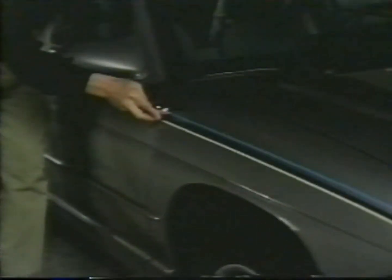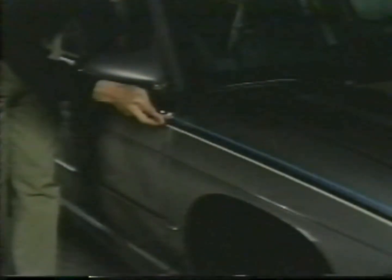As you move from front to back, be sure to remember to smoothly walk backward in a continuous motion with a toe-heel step, one foot behind the other. Do not shuffle and keep your painting arm extended. The only reason to move your extended arm would be to avoid a mirror or door handle, or when in a confined workspace. With very little effort, you'll be striping with professional results.